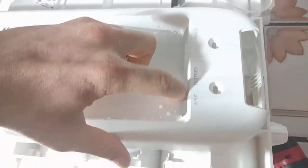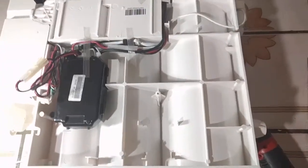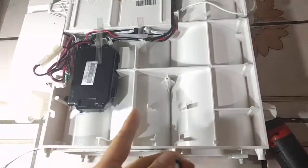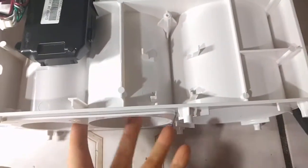When you start to get the clips off, just try to make sure this lip doesn't catch your adapters that hold in the water hoses, because those will break or pop out. Once you do that, there's four screws on the bottom which hold on the rubber feet but also hold on this. And then there's also a bunch of screws in the front around the bezel, which are fairly obvious. You can see one of my clips actually broke right here. There are six screws here — you want to do all those. Obviously you have to have the filters out, and then this whole assembly will slide out.